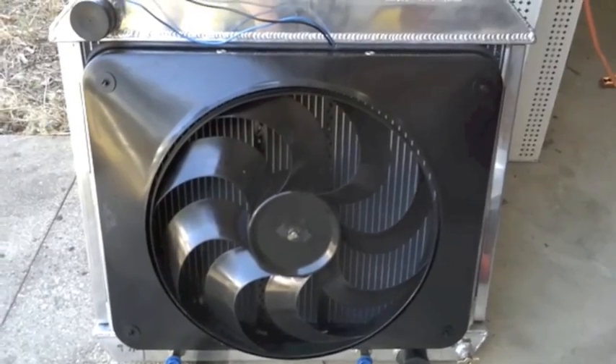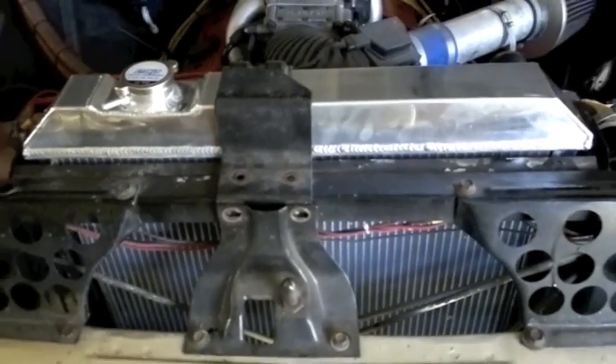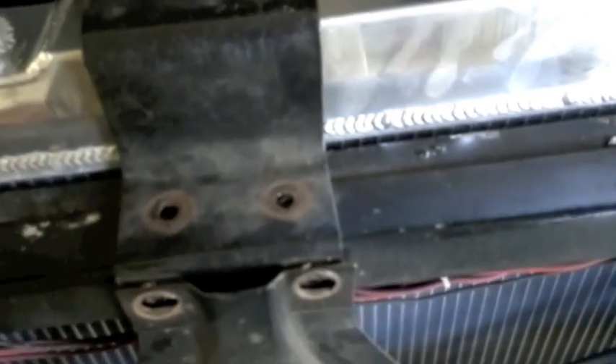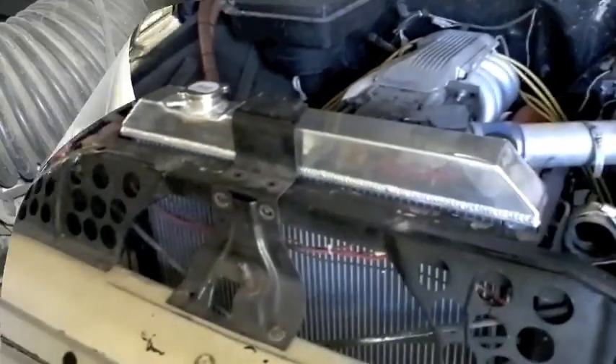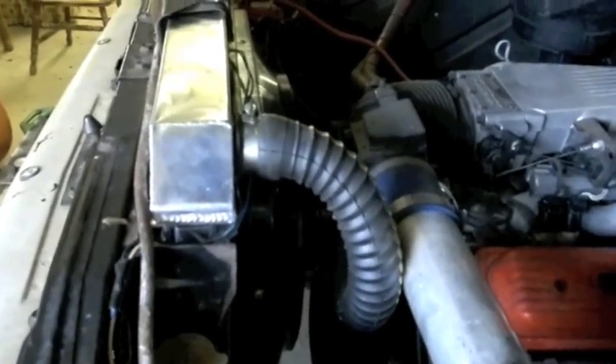Here's the first test fit — might actually be the final test fit. I've adjusted all the brackets so it looks great. It still fits even though it's a fatter radiator — I removed one layer of rubber padding from inside and it fit like a glove. She's all back together, and a little bit of modification on the mounting assembly and a little bit of MIG welding — it is good to go.